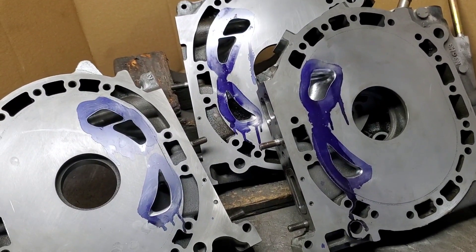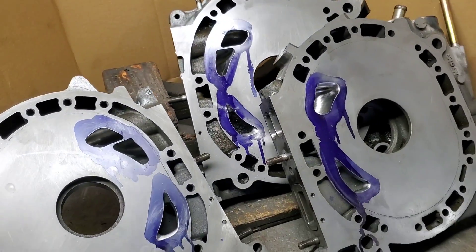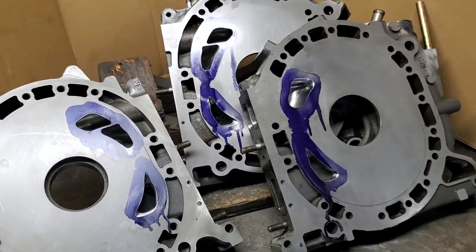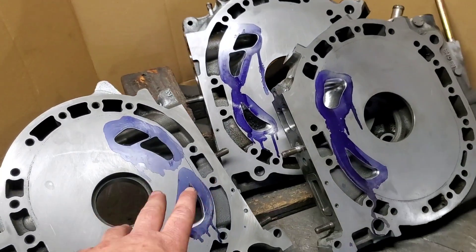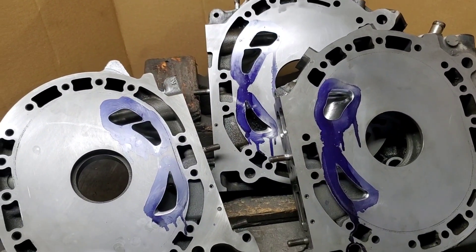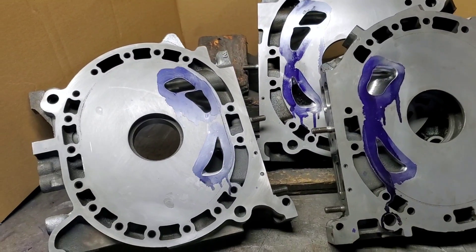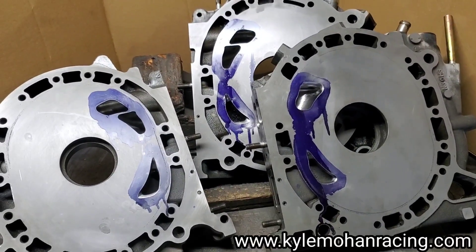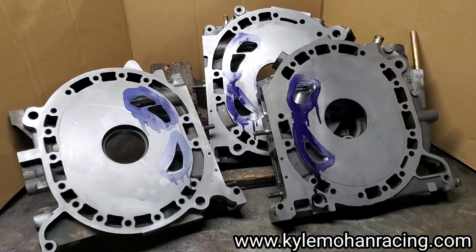Make sure to check your local smog laws. I do know that some of these street ports do pass smog, but before you modify your car, always make sure you're falling within the limits and liabilities of what you want to do. Street porting is a great option — RX-8s love to be ported just like any other rotary motor. In this case, lapping these housings gave them a second chance. They're not going to get nitrided, they're not going to get WPC treated — they're going to go out there and have some fun. Probably last over 50,000 to 70,000 miles in normal use.